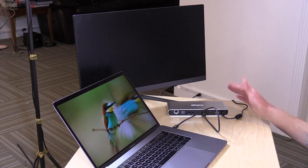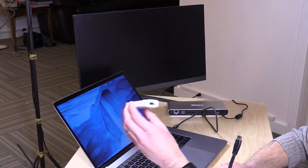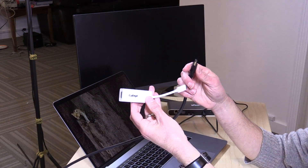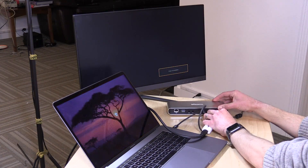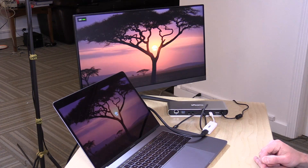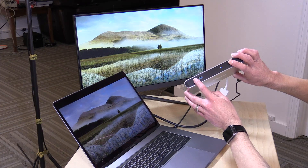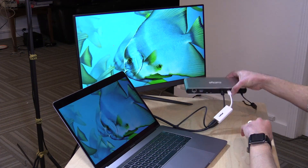Right now all these ports are active, but my display is still blank. My challenge is that my display only supports HDMI and not DisplayPort, which is on the back of the dock. You could get a DisplayPort to HDMI cable as one solution, or you could use a USB Type-C to HDMI adapter — which CalDigit makes for your convenience. You plug that into the Thunderbolt port on the back, and the display extends out to the second monitor. Note that although the front has a USB Type-C connector, it does not transmit video — it's data only.